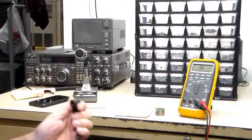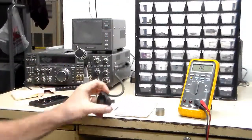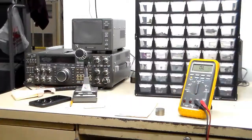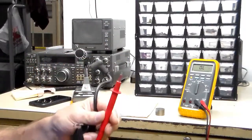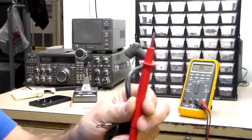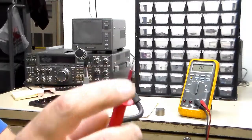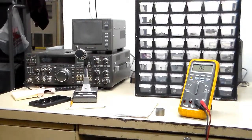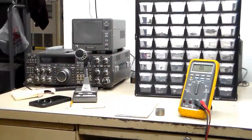If I really want to check the coil and see if it works, I'm going to connect the spark plug side to the oscilloscope. I'm going to take a little magnet and go in and out with it, and I'll show you on the scope what happens — how it induces a voltage and makes a big voltage on that side. You might notice the little red lead on my meter has insulation there — that's good when you're doing tests and have to reach inside with other components. I just like to have just the tip exposed so when I touch something I don't short it.